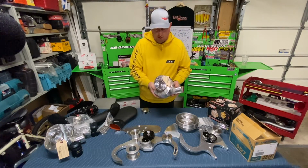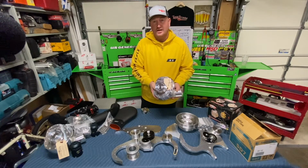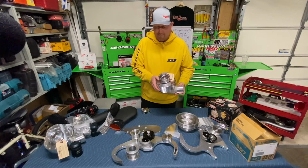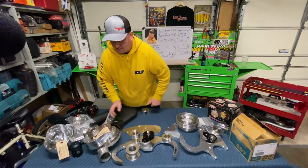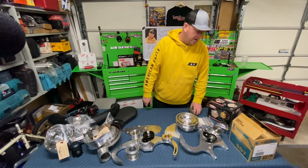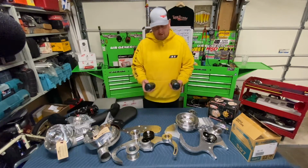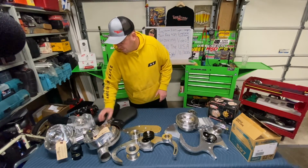I think Torqstorm goes all the way down to 3.1, and I know I've seen guys online that say they're getting custom pulleys, maybe as small as 2.75, and that'll get this thing to spin a little faster. But obviously you've got to have all your other upgrades in place so you don't damage anything. But again, these really nice billet blow-off valves, these things are sweet, and I'm looking forward to setting that whole system up.